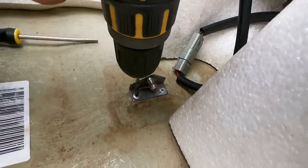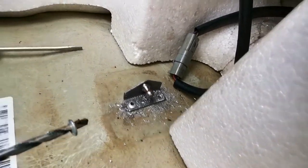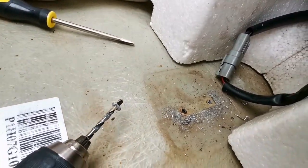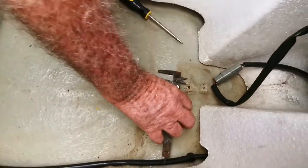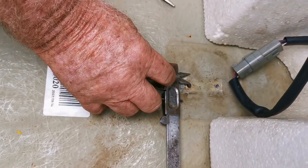We're back with a 4.5mm drill bit. There's one out, that's out as well. Got a set of calipers set for 15mm — that's where the centre of the hole is. Just push it under that wire.